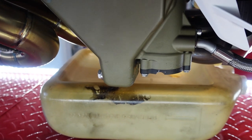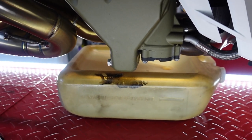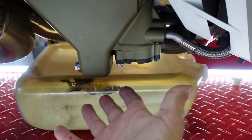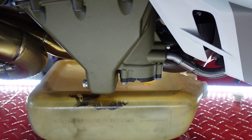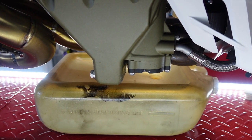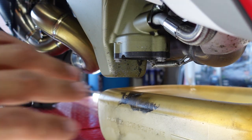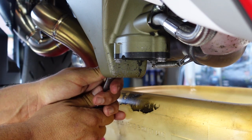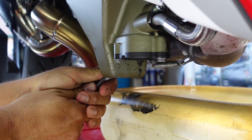Let's go ahead and switch over to the GoPro and talk about what we're going to do — basically just drain the oil. It's pretty simple, especially on the Street Fighter, it's all nice and exposed. Let's get that nice and open and start draining. The first thing we're going to do is crack with our 14 millimeter — just crack the drain plug loose.